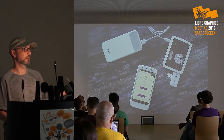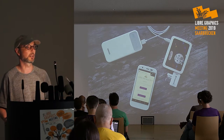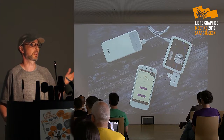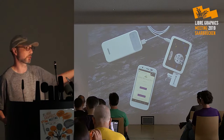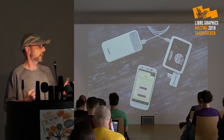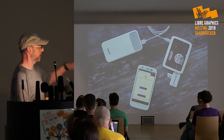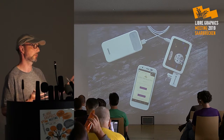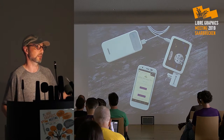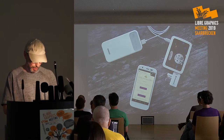The second mode is camera mode, which uses a script based on Gphoto. As soon as you connect your camera directly to Little Backup Box, it offloads all the photos to the backup storage device. The third mode is remote control mode, where you can perform simple actions or trigger card or camera backups manually. Little Backup Box also has DLNA and Samba services you can activate from the web UI, letting you stream photos to any DLNA-enabled device like a smartphone or TV, and transfer files to other devices using Samba.